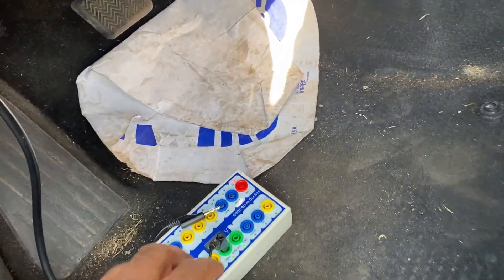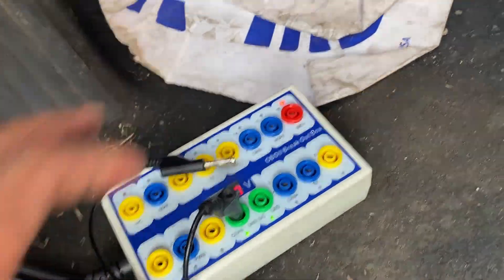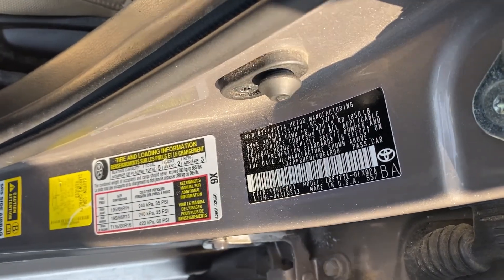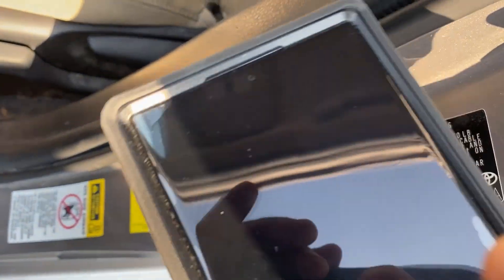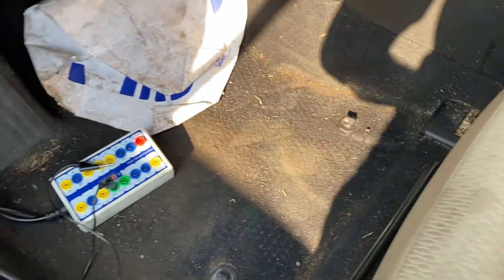After you connect the jump between pins 4 and 13, leave it on for 35 to 45 minutes. When you come back, write down the VIN number. The best way to do this while I'm recording the video is to take a quick photo with my other phone and get a record of the VIN. It's very quick and easy.